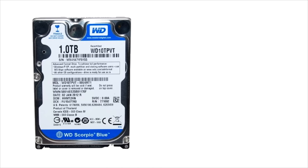We're going to be needing a few things for this procedure. The first thing we need is a replacement hard drive for the PlayStation 3. This hard drive is a 2.5 inch hard drive — the same size you'll find inside a laptop computer. It needs to be a 2.5 inch drive in order to fit; anything bigger will not fit. It also has 5400 RPM, which is the speed at which data is read from and written to the drive. Sony does not specify RPM limits, but most people recommend a 5400 RPM hard drive, so just get one with this speed — better safe than sorry.